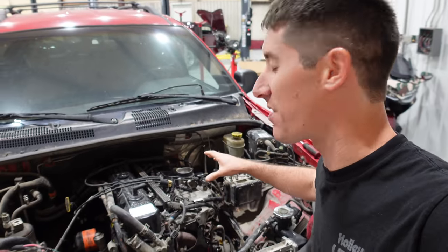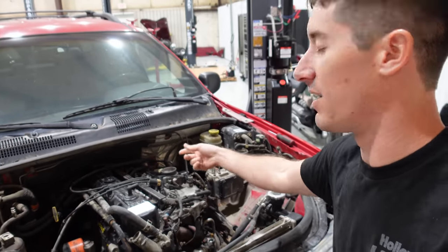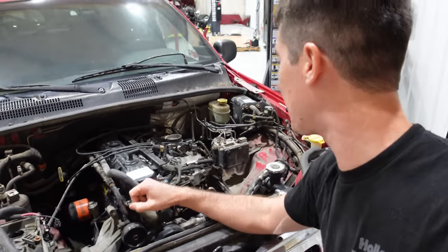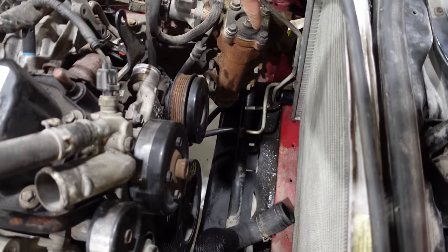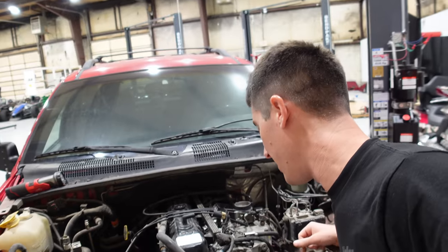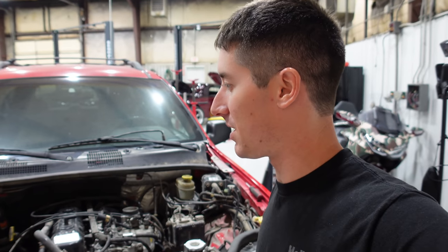We're making some good progress here. I went and got the throttle body off the old engine, put it in the parts cleaner, cleaned everything up — obviously being careful not to get too much solvent in the IAC. That's back together. Almost every single thing's back on now, really didn't take too long at all. I've been looking all over for a hose clamp for a transmission cooler line that I can't find anywhere — one more transmission cooler line needs to be hooked up. I looked all over, cannot find that clamp, so I'm going to have to go with a worm clamp on that. As soon as that's done I can put the lower radiator hose back on and everything else can go back in. Something always goes missing — if it doesn't, I guess you're doing it wrong.